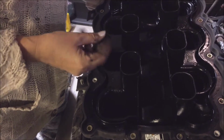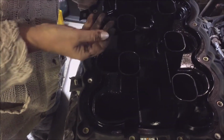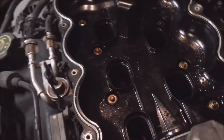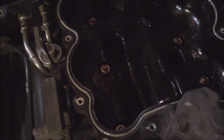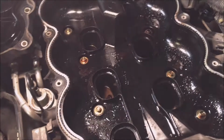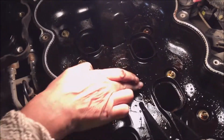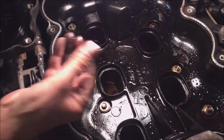Oh, wow, that's going to need a good cleaning. It actually feels kind of grimy. It looks oily to me. Oh, yeah. Put the light in this side. Like it's extreme. It's extremely oily. Wow. Yeah, and that oil's going in your engine. That should be clean. Look at the oil in there. Oh, wow. That's from your PCV valve.